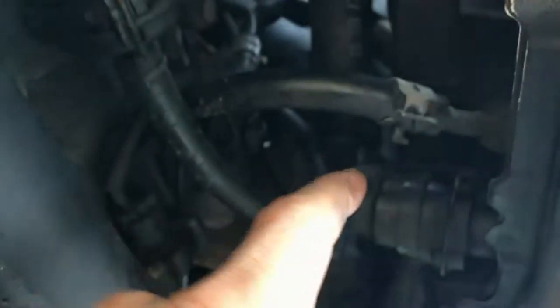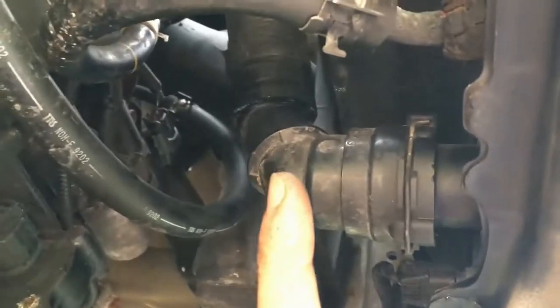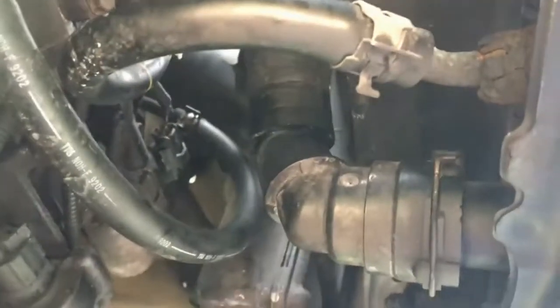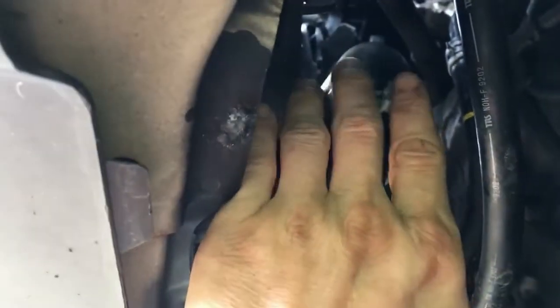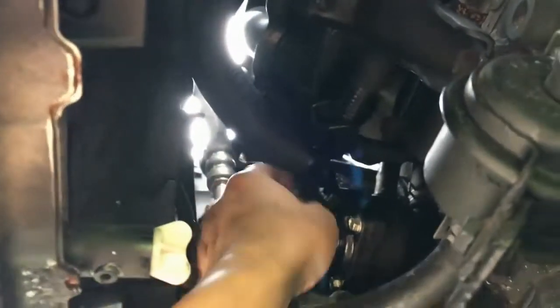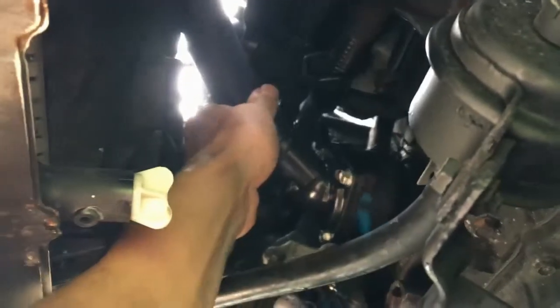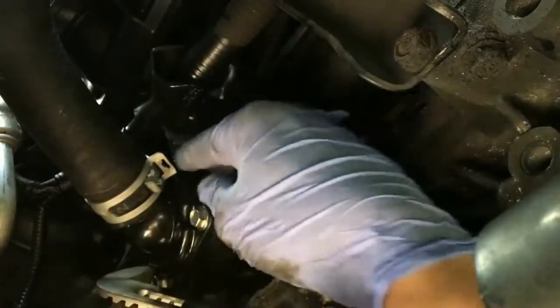So I'm going to actually, again, point of reference, here's the petcock towards the driver's side. Up over on this housing is where the lower part of the lower radiator hose is going to go onto, but I'm going to drop the camera for a second because I want to put one hand here and one hand here as I fit the hose onto the housing. So this housing, I put the hose onto this housing all the way to the end, and all I did was I slid the clamp down. I'll release it in a second. And now for the thermostat part, I should like to get it up here a little bit. For the thermostat part, which is the top part of the lower radiator hose, which is here, this thermostat is on there pretty solid. It's bolted on, so I'm just going to do this by hand. Fit it on here, and then just slide that bad boy on there. Just going to pinch it right about there. And there we go. And let it release like so.